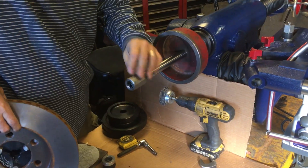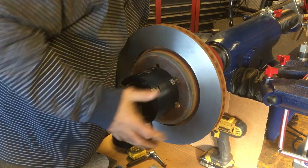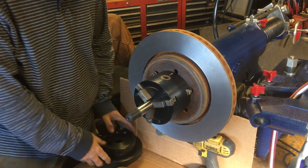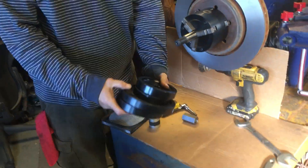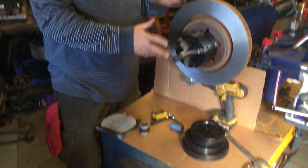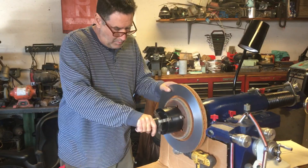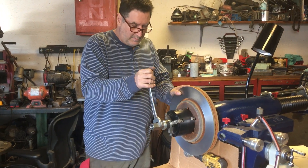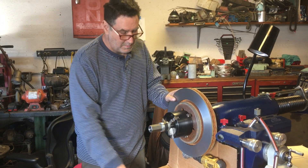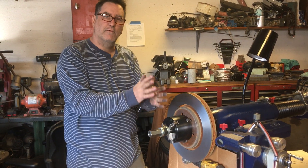They're convenient and they're fast. They come with these plates here, and these are great — I love every one of these for specific applications. These cover just about every car out there. It's only when you get up to the biggest rotors that you need something more stable, like this giant cup I have over here. There are several different brands of cups, but the real important thing is that you get this on there and tighten it. I want this spacer here next to the nut that allows all of those cups and cones to stack off of the one true face.